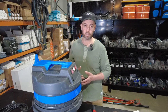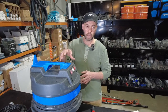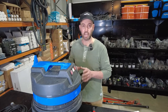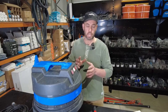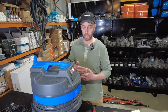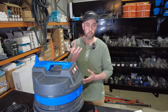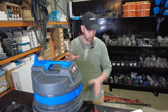Each motor has a different wattage per vacuum type, and on this Skyvac Industrial 85, it is 3300 watts, with three individual motors at 1100 watts. So it's very important in the way we maintain our vacuum and look after our filter quality, keeping that filter in as close to new condition as is practical in a gutter vacuum system. Going forward, after your initial purchase, have a spare filter cartridge and change out that filter cartridge, making sure the seals are in good condition top and bottom to prevent ingress of debris into your vacuum motors.